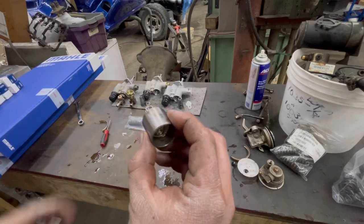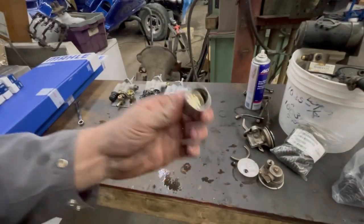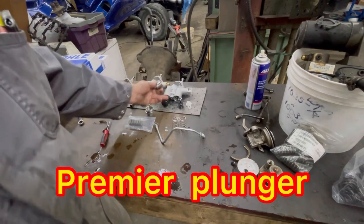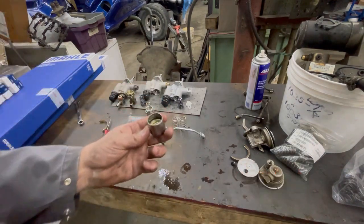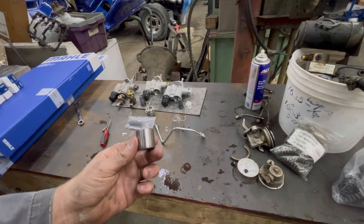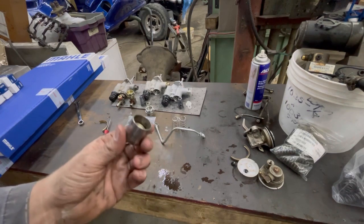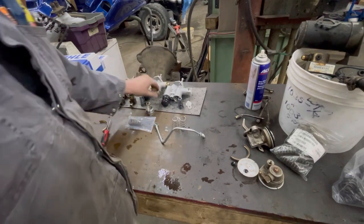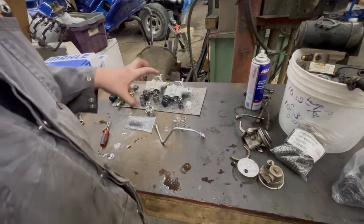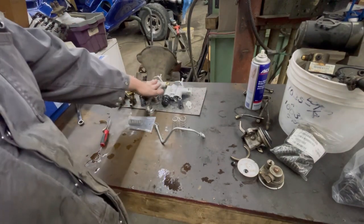So this is the big bore — that's the difference between the two. This is a very simple pump, and these are just better in my opinion because they don't have a diaphragm to fail. They do have one seal but very seldom do they fail. Sometimes the plungers fail, but I don't usually see that on a VE application because you're turning the pressure way down — around 10 to 15 PSI on a VE truck, versus 50 PSI on a P-pump truck.